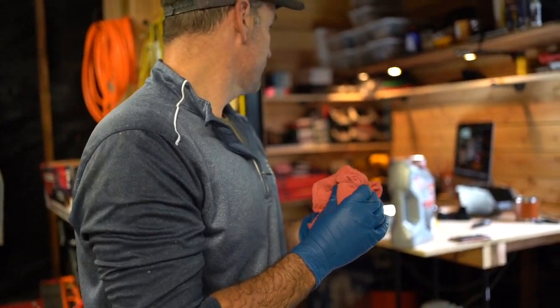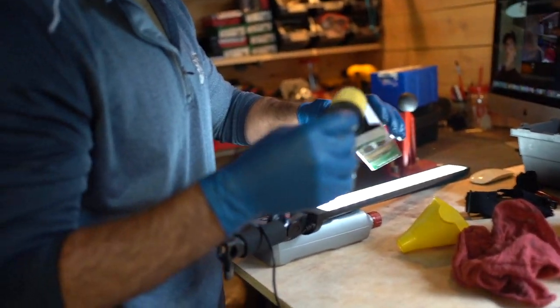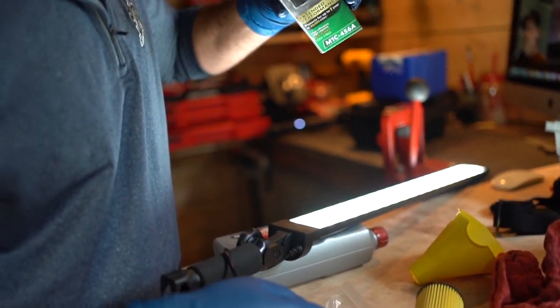Jose! What now? Do we put the new oil filter on? Yeah, so you go ahead and do that. When you look in the box for the oil filter, my guess is that you're going to see at least one gasket, if not a gasket and a washer. Well, let's have a look. There is a gasket, yes. Okay. So you'll notice in your oil filter cap that you took off that it's going to have a rubber gasket around it, and you'll want to take that gasket off and then replace it with the one that was supplied. Usually a pick will work for that.